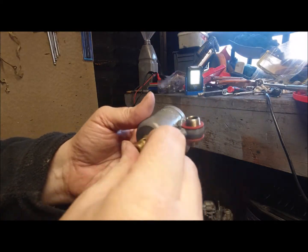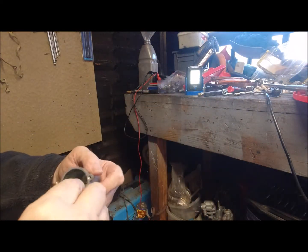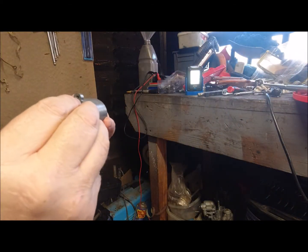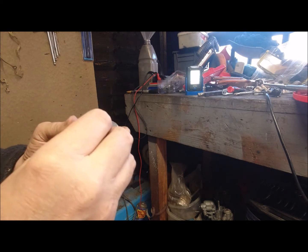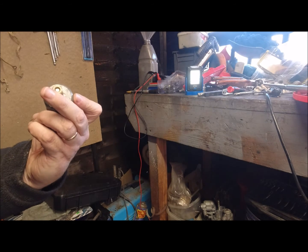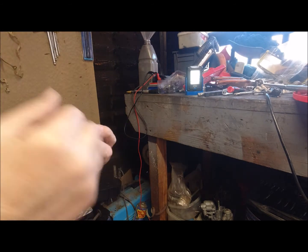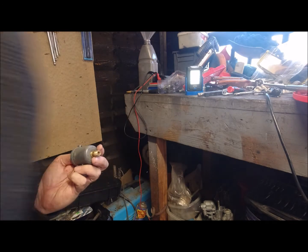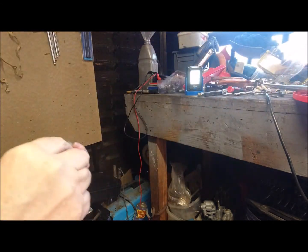needle in up there, and if you see it come through there, then we want our float down on it, and we just push the needle with a little screwdriver or a pin, whatever you want, until it clicks in. A screw, I'm hoping that will go in. No, don't be silly.